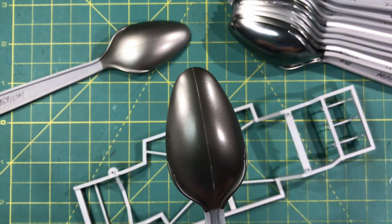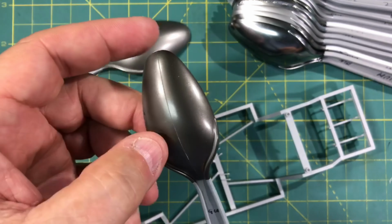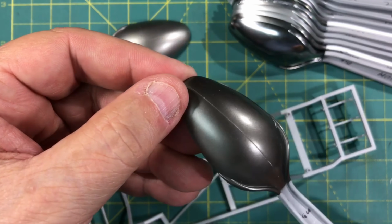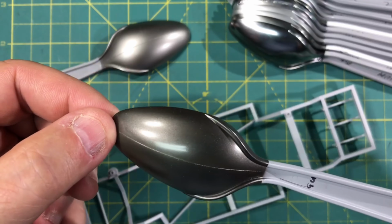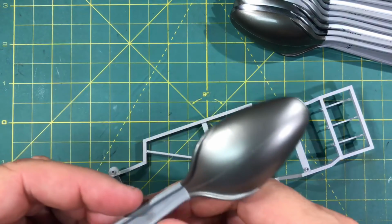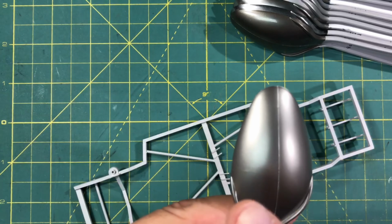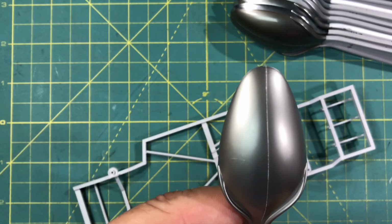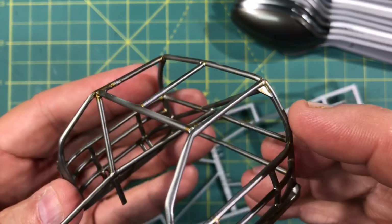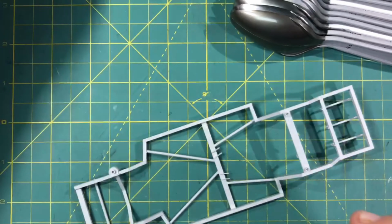And you see the split in the spoon, and what that is, one side is gray primer, one side is white primer, and with some of these colors, it's hard to tell the difference, but you can see sometimes just a subtle difference. But like I said, for my taste, the all clad steel is a little bit too dark, so I like to use magnesium. It's the next step down, but this is the all clad magnesium over the gray and over the white primer. And again, there's a subtle difference, and on our Fab Shop car that I showed you, the roll cage and some of the chassis you've seen, it gives it a good steel or metal finish.